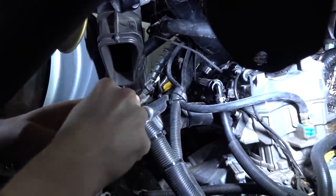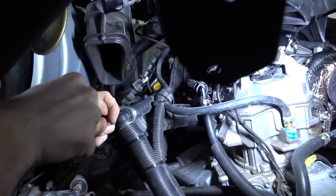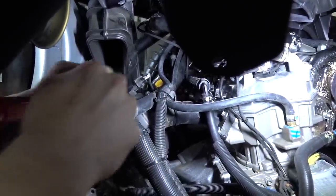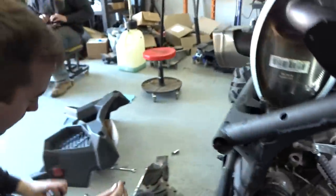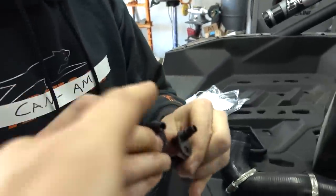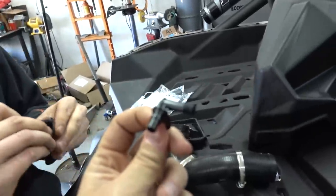Rick pulled off that little T-30 on the intake manifold and there's a little tab you have to gently pry out — that contains the O-ring used for the boost reference for the Evo kit. So you take that O-ring off, put it on the new adapter fitting, and that gives you a port for your BOV. Boost reference is up, exciting!